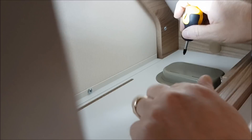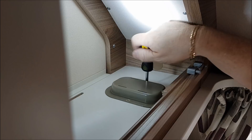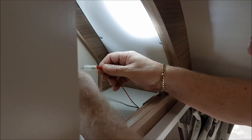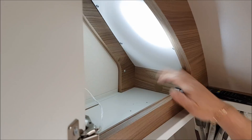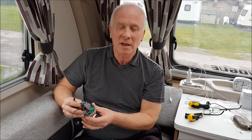On to the second one now. This is the front one — this should be relatively easy. You've just got to remove a screw either side of the cover here, and that just comes away. You've got your connectors — just undo those. The light just pops out, and that's as easy as it is. The second light I'm going to pop up there. There's no point in me showing you how I screw it in because you've just seen it — it's very straightforward and plugs straight in. I'm going to put the other two up and then do the master switch override.